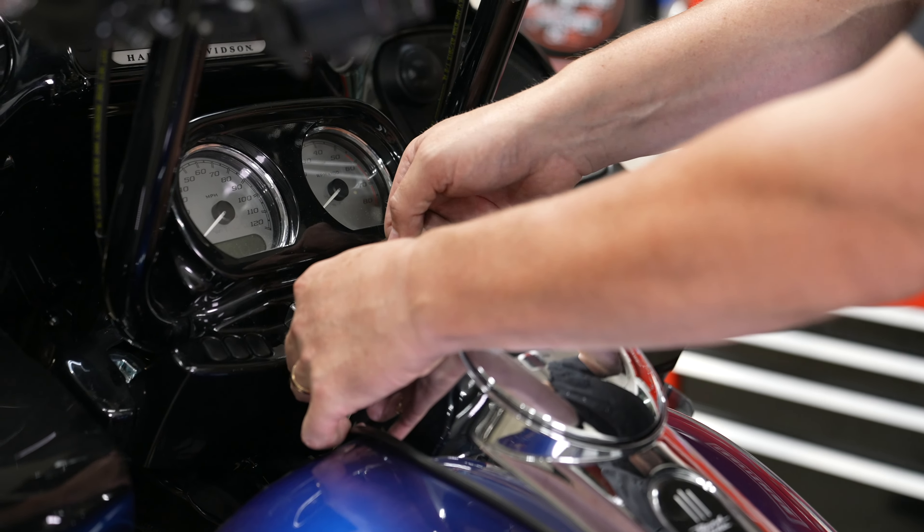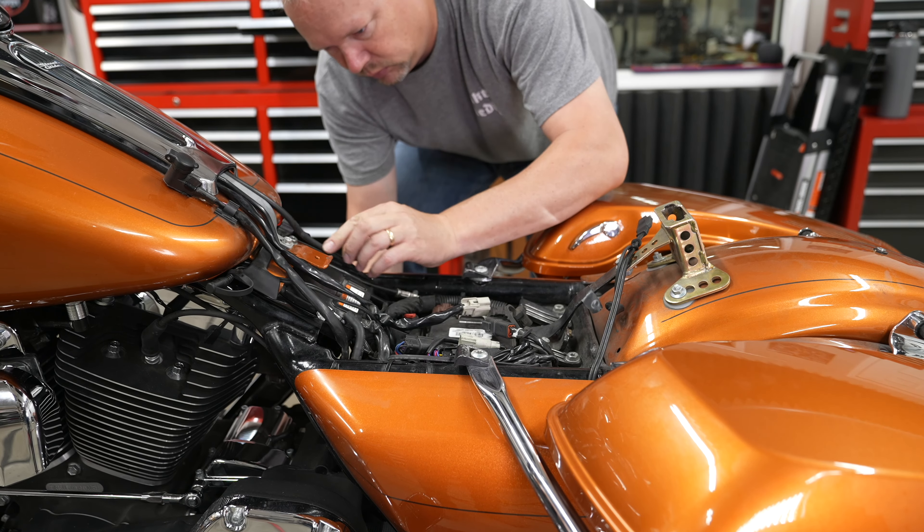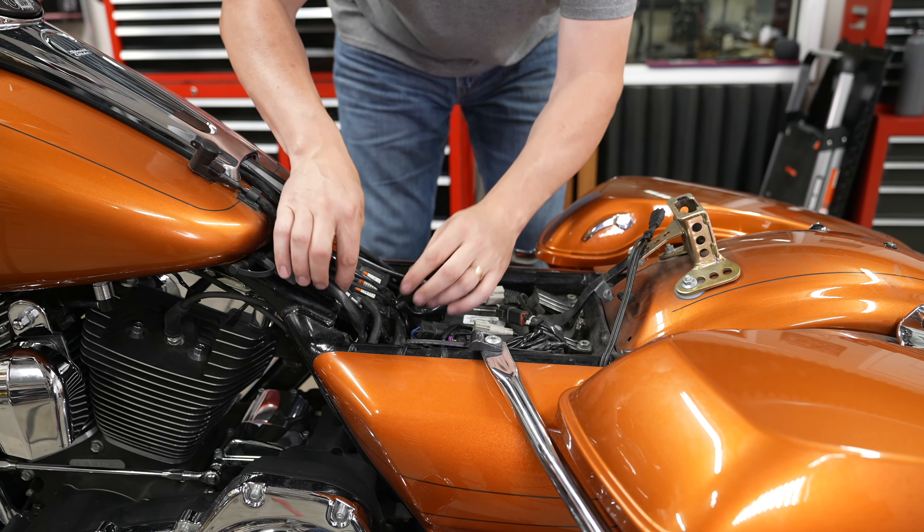He's going to hook up his fuel line: pull up on the chrome collar, push up on the black portion, and you'll hear it snap into place. Then get the right side vent line and fish it down through the right side of the bike — when it's stock it is zip tied and you can certainly put a zip tie back on. Over on the other side, pop that vent line back together and then grab the gray plug — it only goes one way, so make sure it clicks together.